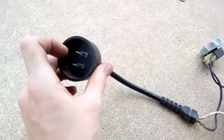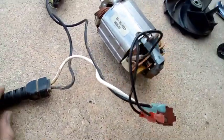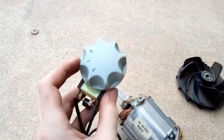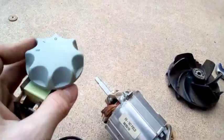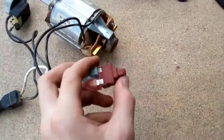First, there's a live and a neutral that goes to the tiny extension cord. Neutral just goes to the switch; live goes to the speed selector — I'm pretty sure it's just a resistor — so there's off, there's on, there's ultra speed or whatever. Then that leads to this push button, which I think is a reset switch.